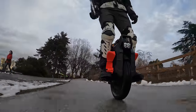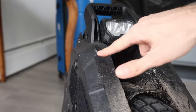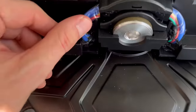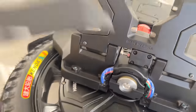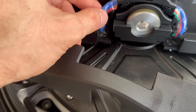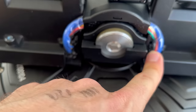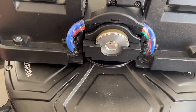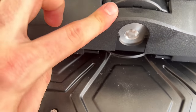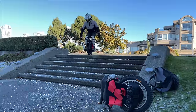We should have enough power and headroom to push it hard. The battery pack is also protected by a magnesium shell and plastic on the wheel well, so it should be fairly safe in terms of impacts. One thing I really don't like is at the bottom of the wheel there's a plastic cover, and underneath that cover you find high voltage wiring connecting the two sides of the battery packs together. This should be in a more protected area — definitely not where water ingress is possible or where silicone can wear off. Check on that when you receive your Sherman.